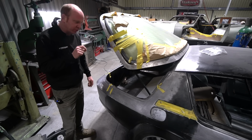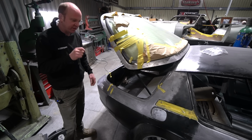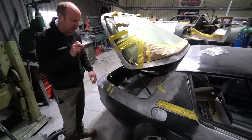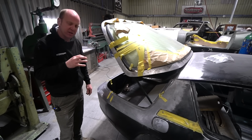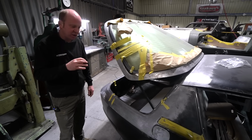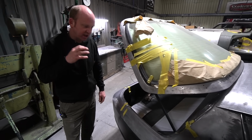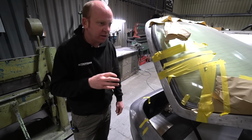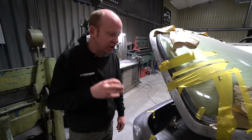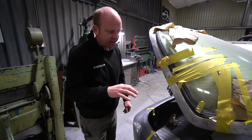I'm happy enough to run a fuel line within a car if it is a double covered line. If it's a stainless braided, Teflon lined type line, I will be happy to run it inside the car, but not when it's a fuel filler diameter, and certainly not if it's a pushed on connection with a Jubilee clip on it. The chances that if in an accident that parted company inside the car, the fuel leakage in the car would be colossal, and it is really just not something I want to do. Not happy with that arrangement at all.